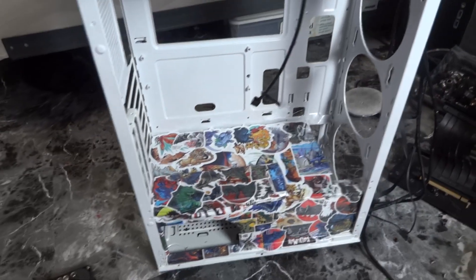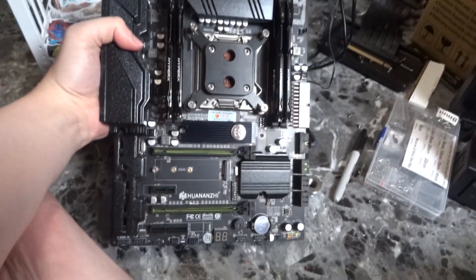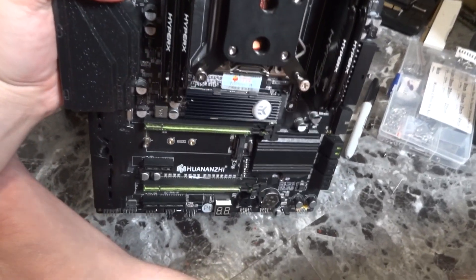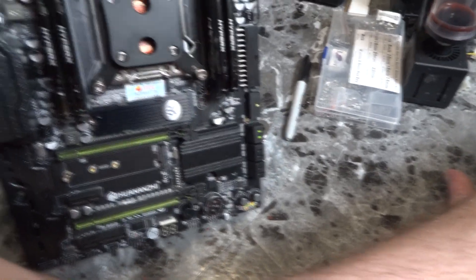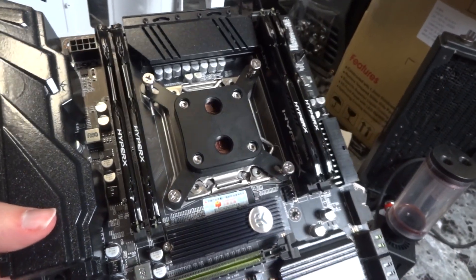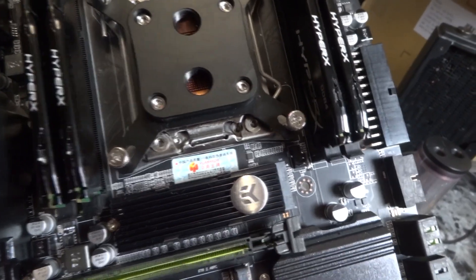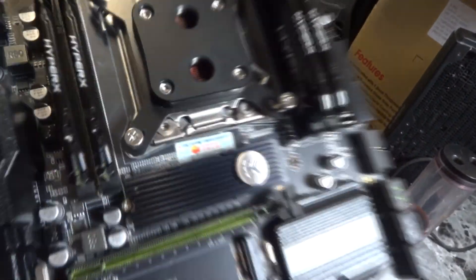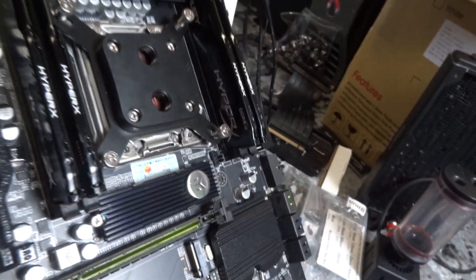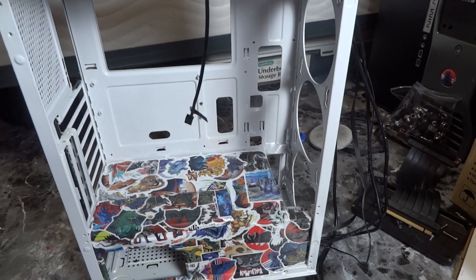For CPU, RAM, and motherboard, I figured there was really only one option: the X79 Green. As you guys can see, I painted mine almost completely black — even the tops of the PCIe slots are now black — and I did test everything, it still works properly. For CPU, the best value-for-money choice was the E5-1650 V2. For RAM, I went with 32 gigs of DDR3 ECC registered memory from Micron rated at 1866 CL11. I'm hoping everything performs very well. Building this thing is going to be a pain, but it's going to be fun — so let's start, shall we?